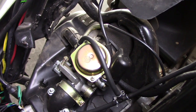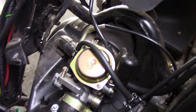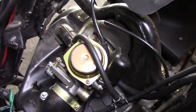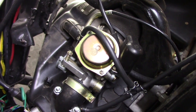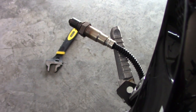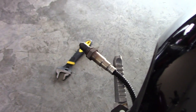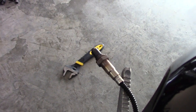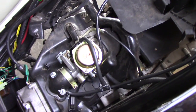To start the tuning process, the first thing I need to do is take off my air filter — I just have a foam one — and I clean it up once a year. I only ride about three miles to work on roads, nothing dirty, so I just put it up to a shop vac and clean off any dirt or dust. I'll also make sure my wideband sensor is calibrated — I removed it from the exhaust bung and I'll go through the steps listed by the manufacturer. You put it into the air, run the calibration settings, and it'll confirm the reading is at 22.4, so you'll get an exact reading.